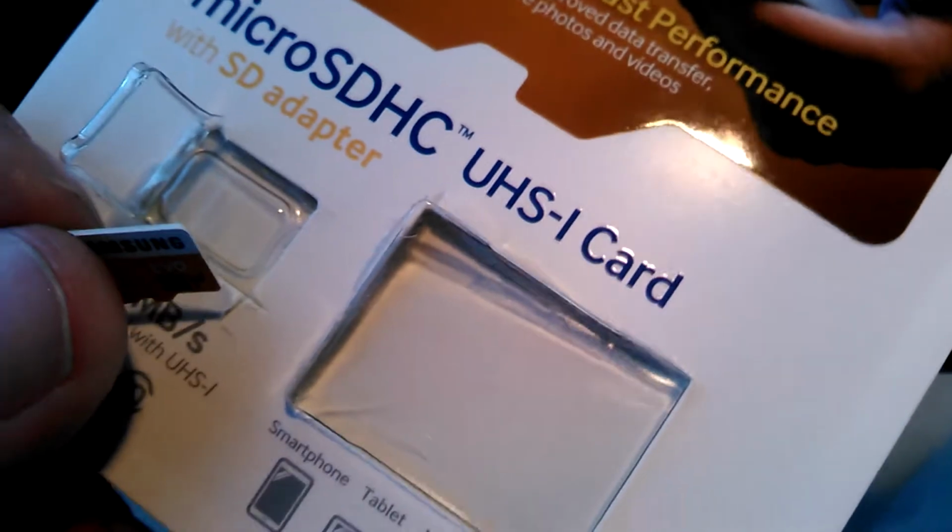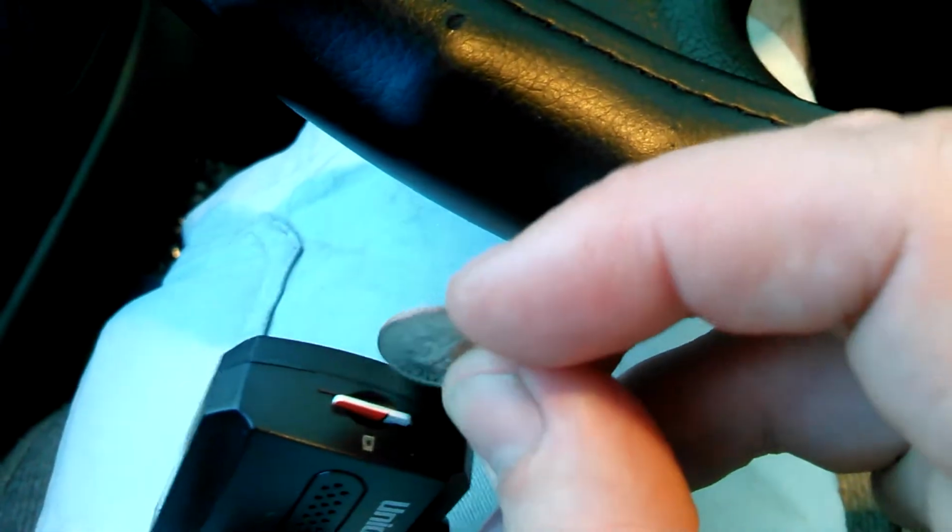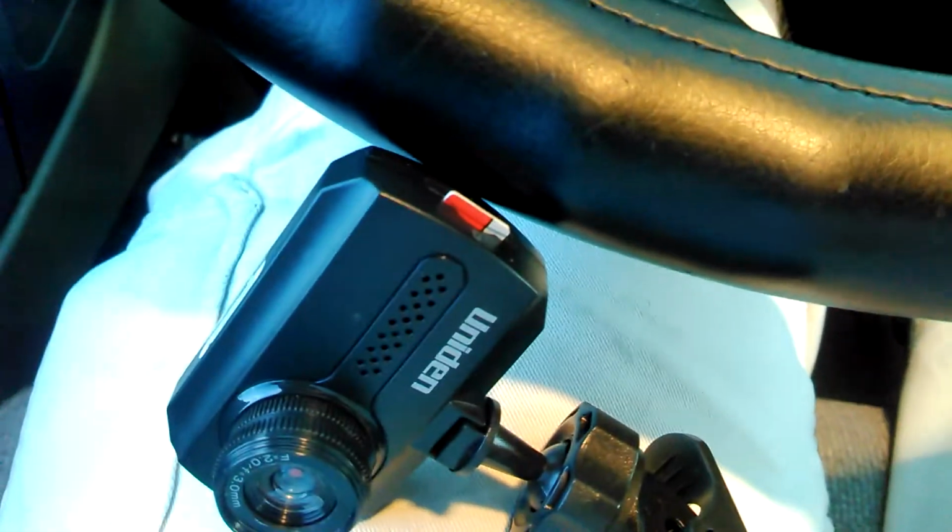So okay, so just to get them out, I had to take a knife and cut along one side and along another, just run the blade across a few times. But here's the crazy part: the dash cam itself here, the card is right here, okay, and this is the new card that you want to put in it. To get this out, the only way to get this thing out, let's see if I can show. Yeah, see, they've got it in here so tight that you could use the back end of a knife blade and push in, but so not to damage the card, this is my little trick. You just hit a dime on top of it, and it, if I can get it on camera here, because you can't put your fingernail in there even, but a dime does a good job, and that's my little trick for that. So hope that was helpful.